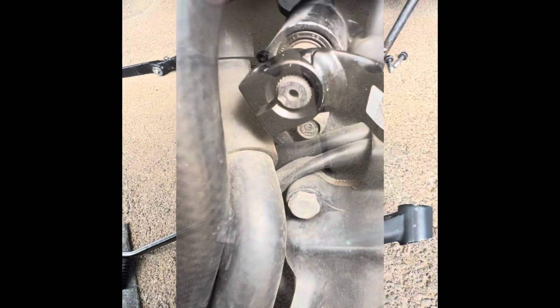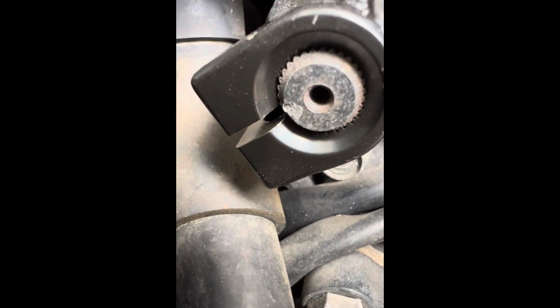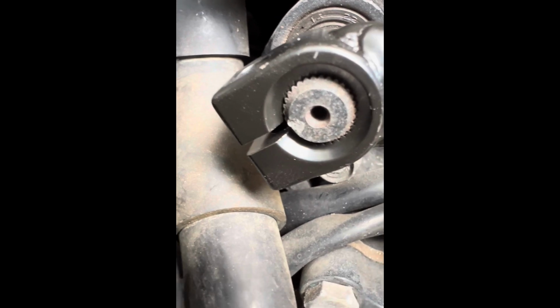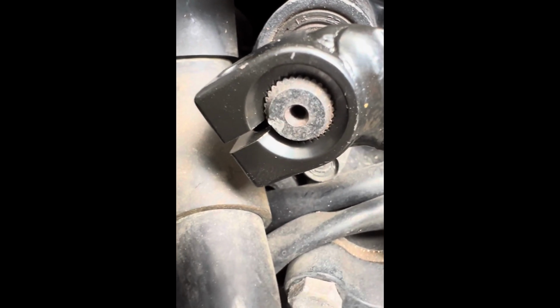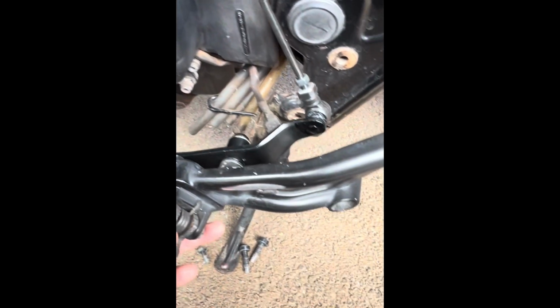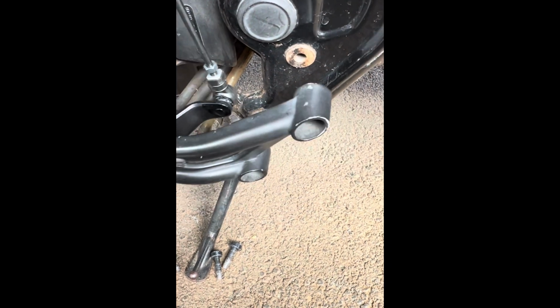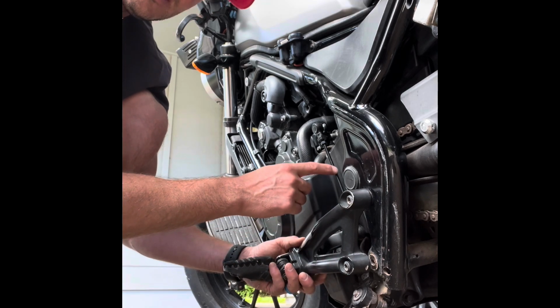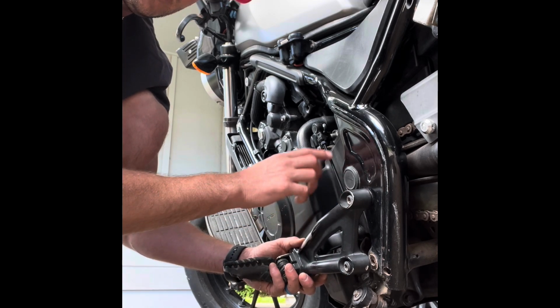That's my old one. Here's the new. Tell where to put mine because I had that little crack on where it's supposed to be there with that opening, so you want to line that up correctly. And then put these bad boys in. When you reassemble this, make sure you're supporting it because this thing is fragile, the tie rod here.